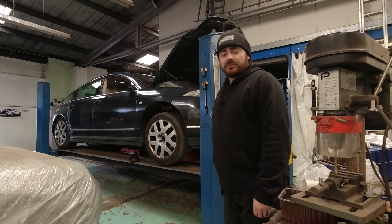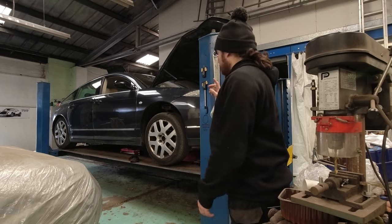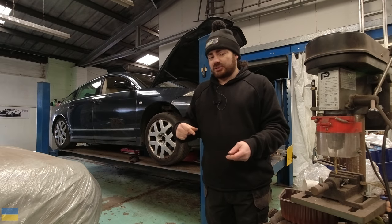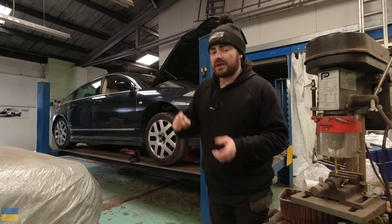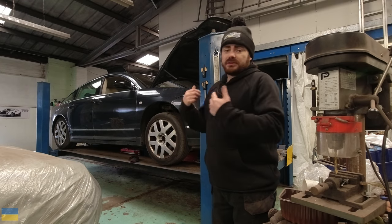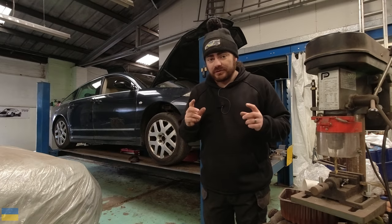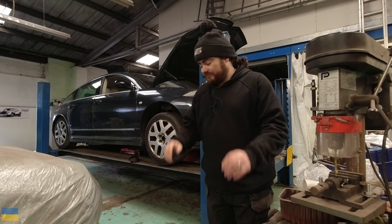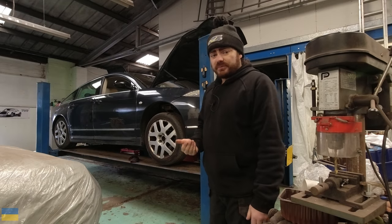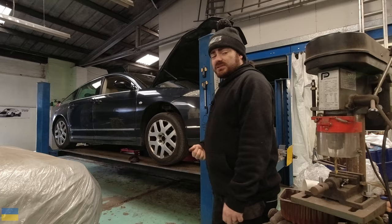Back once again with the Renegade with the C6. The job the other day was to do the drive belt idlers and tensioner. The bearings worked — I managed to buy two bearings and take the tensioner and idler apart, replace the bearings, put it all back together and now it's sweet. New tensioner and idler would have been over 200 quid for both. A couple of bearings: about £11.